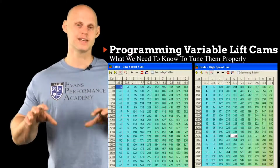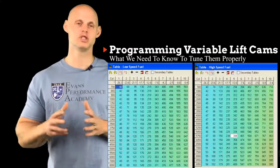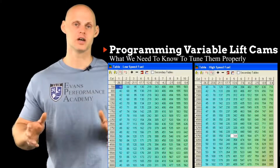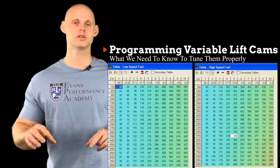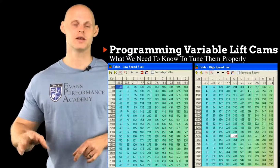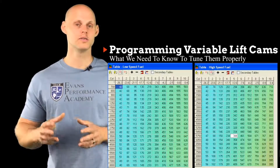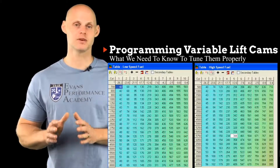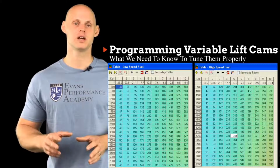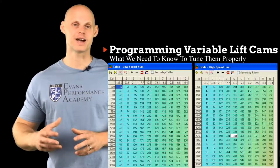So looking back at the table, we can see that the low cam value and the high cam value are relatively a big jump between these two tables. So we can see there might be a 20 to 50% difference in the values in the table, because there's going to be that much greater demand for our air mass coming in our engine on the high cam table. Now that's going to be substantial because we can go ahead and control the fuel delivery just for that specific high cam event. So if we ride on our low cam and switch to the high cam, we're not going to have to worry about blending one gigantic fuel table. We're just simply going to switch over to this table and be able to hit that exact fuel delivery that we want.